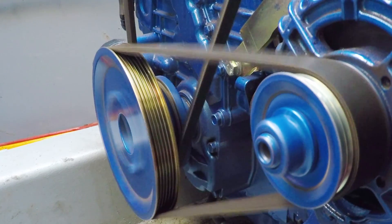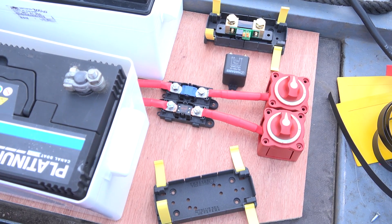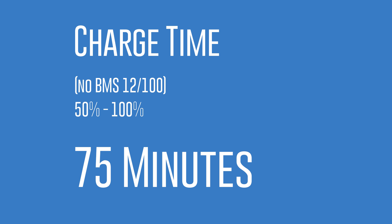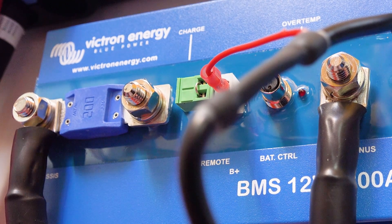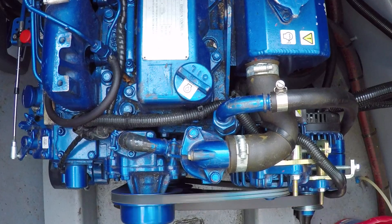To avoid this I have used one of my previous lead acid batteries as a bit of a power dump protector. I will need to have a small load on this lead acid battery, otherwise it won't provide that dump load protection if it's totally full all the time. Before the BMS 12200 was installed, at tick over I would see around 130 to 160 amps being pushed into the batteries constantly until they were totally full. The time my 300 amp hour batteries took to charge from 50% to 100% was 75 minutes. After testing the BMS 12200 with a 150 amp, 175 amp and a 200 amp fuse, I decided to stick with the maximum of 200 amps. This reduced the load on the alternator and you could hardly feel any difference when it was under load, and it worked fine at tick over.